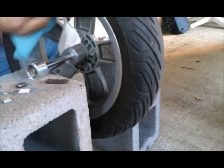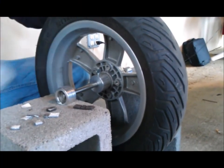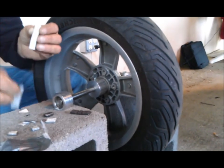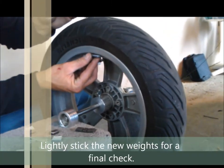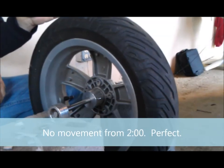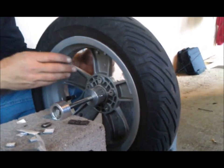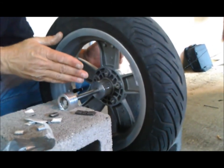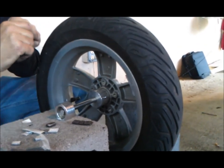So now I want to clean that area. He's just lightly touching it on there in case he has to move it. The other thing is you have it on the outside of the rim. They have it towards the center of the rim. If you look at the mass of your rim, you've got a mass offset already. So I'm trying to keep the mass offset balanced as well. I'm trying to balance the mass. There's no reason to have it there — as long as it's on there, it's really good and it works really well.